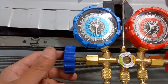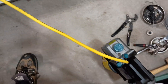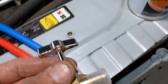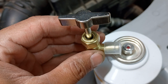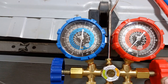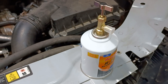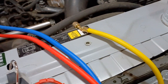Next I close off the gauges to keep all the vacuum within the system. Then I disconnect the yellow line and connect it to the male end of the fitting, and the female end threads into the top of the can. There's a little depressor — as I turn it clockwise it pushes the pintle down so refrigerant can flow through. Turn these clockwise to keep vacuum in the third line, then screw this on manually. Keep it raised or turned counter-clockwise so you're not releasing anything. I put Teflon tape on there and I'll be hooking up the hose in a second.